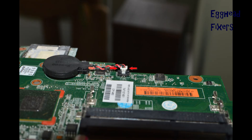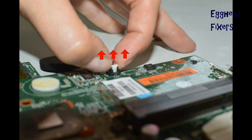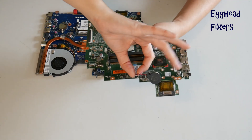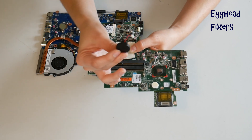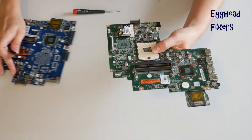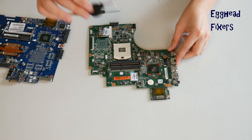Put one finger on each side and gently pull up, being careful not to break that cradle. Once you break that cradle it's extremely unforgiving — sometimes it damages the motherboard to the point where you can't use it anymore. So you have to be careful. Now that you've done that, go ahead and set your CMOS battery and your motherboard aside for 20 minutes.